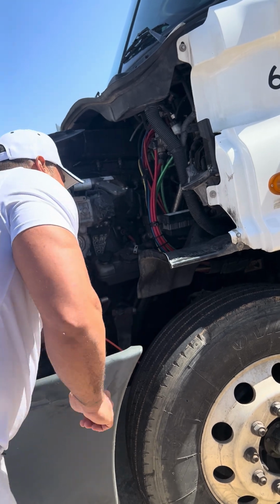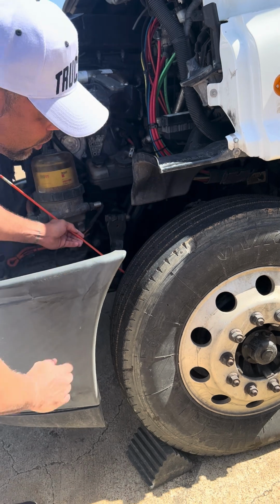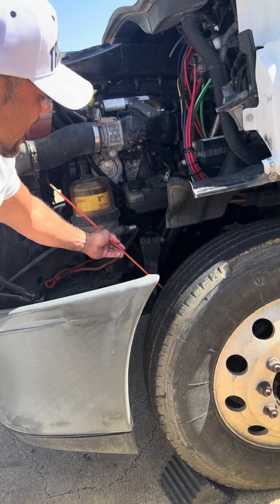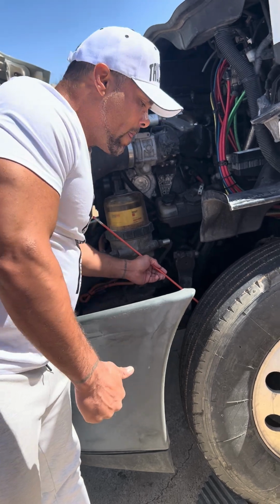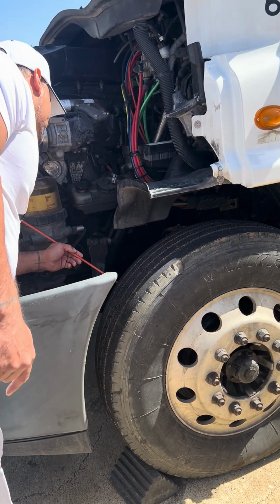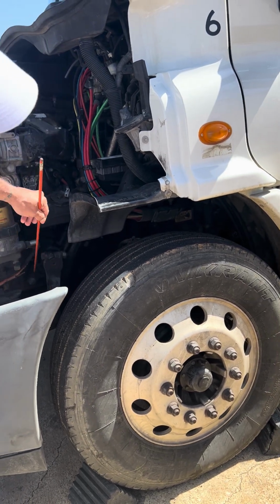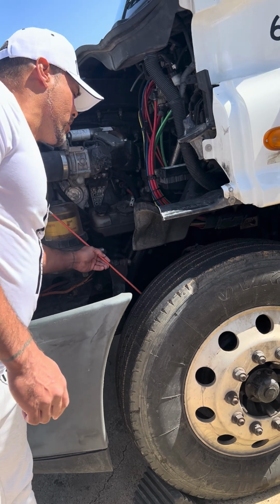That leads down to my brake pads and my brake drum. They are properly mounted, secured, not bent, broken, or cracked. All nuts and bolts are present and tight. I have at least a 1/4 inch of material on my brake pad, and my brake drum is clear of debris, oil, or grease. No illegal welds.